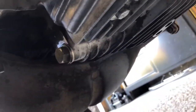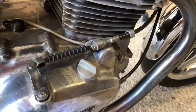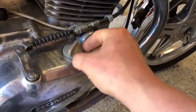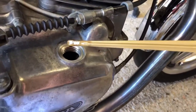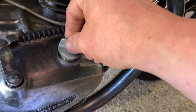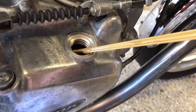I've run the bike since I put the oil in, and now I'm going to double-check to make sure the level is good. On these particular bikes, you take this filler plug out — it also has a dipstick on it. I'm just going to wipe it off, stick it back in. They don't want you to screw it in when you're checking the oil — you just touch it to the top of the case. And you can see we're good. Good to go.